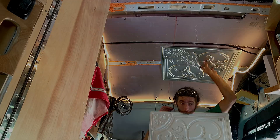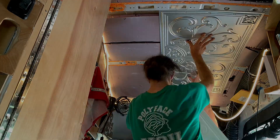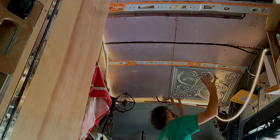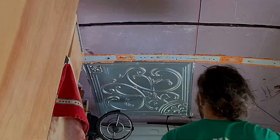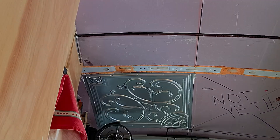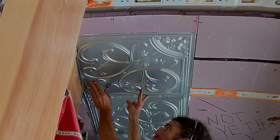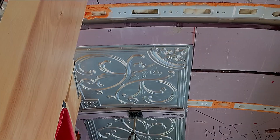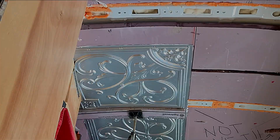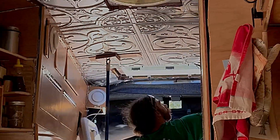The next thing is the ceiling — this is a skinning material. It doesn't add any structure, but it hides the foam. These are PVC tiles made to look like a tin ceiling or metal ceiling. With the Gorilla Glue HD on the tile, sticking it up there — I snapped a line in the middle. That dark line you see is a wire chase where I've run wire through the foam ceiling to get to the other side of the van. There's going to be a whole video on the ceiling installation at some point, so for now let's skip to the end.